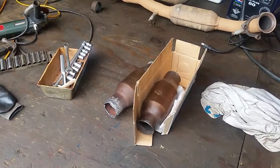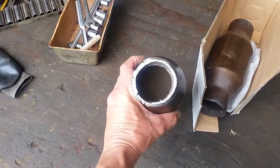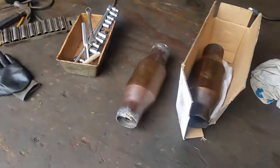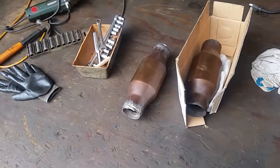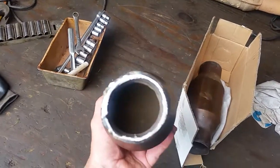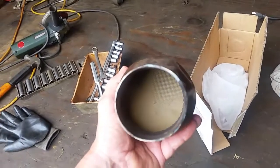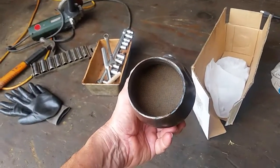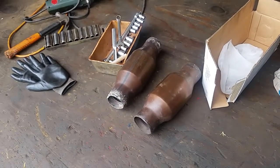In my previous videos, three or four videos back, you can see I had changed out some catalytic converters. I ordered two of them — the first one I stuck on there, ran for a while, and the P0420 came back on. This was a brand new catalytic converter. I called the supplier and they said they'd send me another one for free. I hooked my code reader up, did a waveform, and it said it's not working either. I got real frustrated.